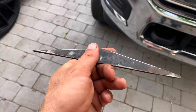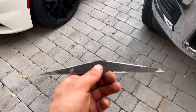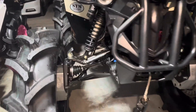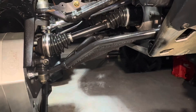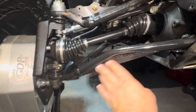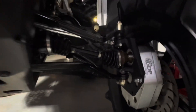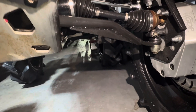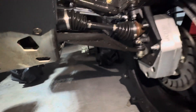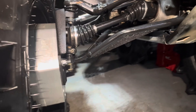Possibly get it burned in this weekend. Today's Tuesday so I probably won't burn it in until this weekend — we'll see how my work schedule goes, but I'll keep you all updated. Alright guys, here's the final product. I recorded this video once and messed it up. Gussets on both sides — this side was the side I did first; I had to take a second to play with my heat range, get everything figured out, wire speed figured out — it was a new machine I was messing with. But there it is: a whole lot stronger than the factory ones were.